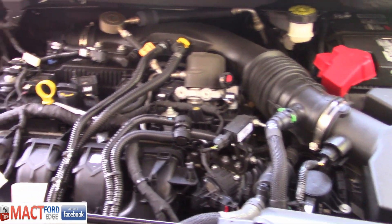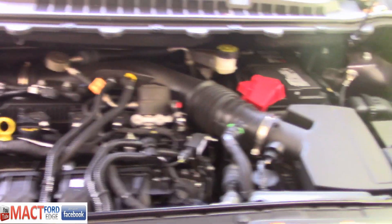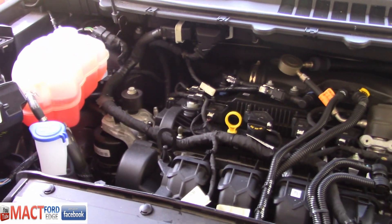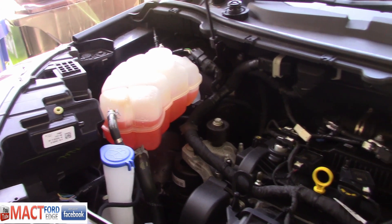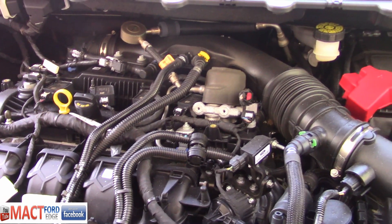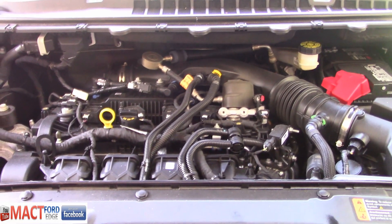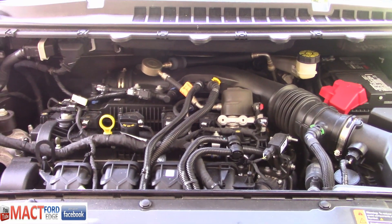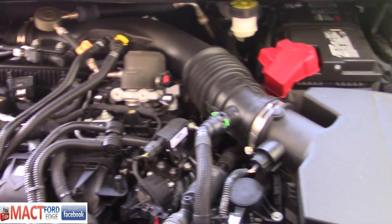As long as you know what the issues are, you can plan ahead and make sure that you do the coolant flush appropriately using the right tools. I'm not saying you can't do a drain and fill — I've never done it because I'm going to use this system to create a vacuum and do the flush that way. I'll show you how that works, and I'm sure others do just drain and fills and work perfectly fine, but for this time we're going to go ahead and use that tool to do our drain and fill and change out this orange coolant.